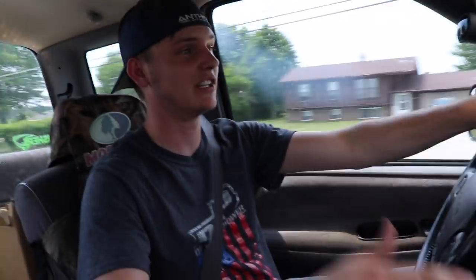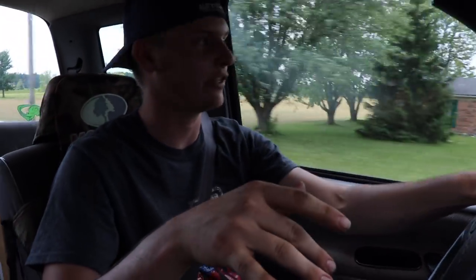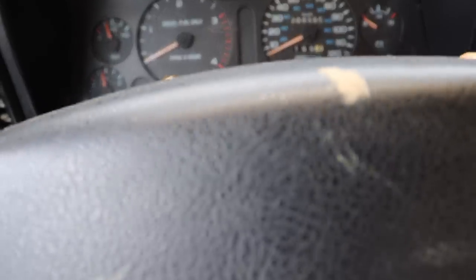It might have something to do with the hot air it's pulling in, but I'm definitely going to tune my AFC housing down some to see if that helps, because I want this truck to run a lot cleaner for whoever wins it. That'll also help with fuel mileage and actual usable power, versus right now it's too smoky. But that's nothing I can't fix, honestly. All that aside, it moves — it's fun to drive. The power delivery is so smooth. You don't feel like you have to really hammer down to move the thing. It just goes. When you drop it into fourth especially, after going 30-35, you drop it into fourth and you just hammer it — it just flies. It's awesome. Man, I love that truck.